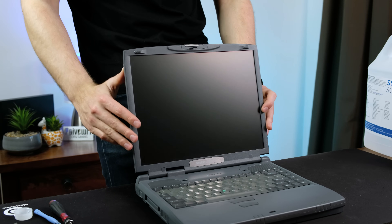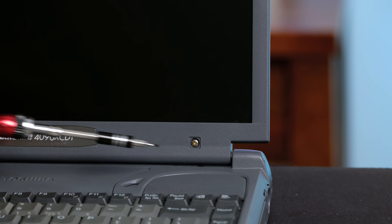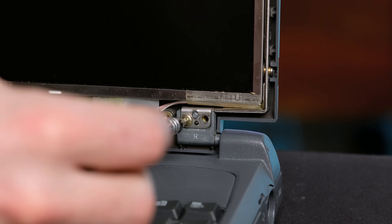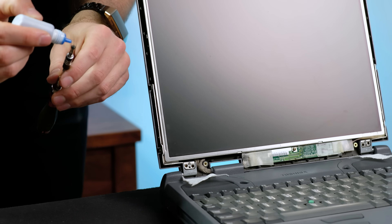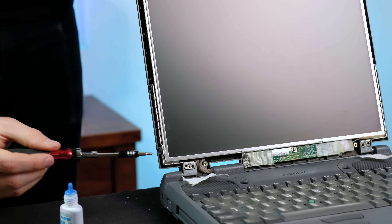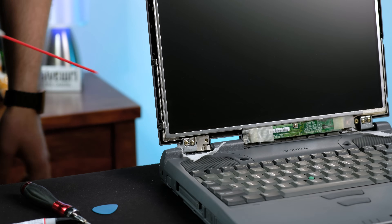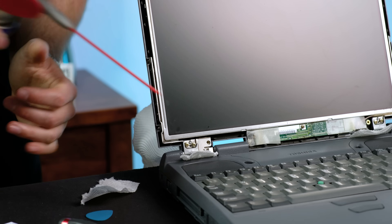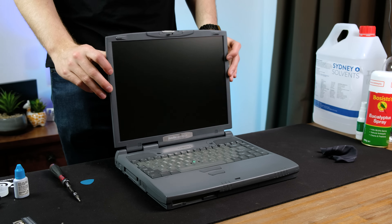We still have a very big problem — the hinge is so stiff that it feels like it's going to snap. To open up the display assembly, I removed two hidden screws and carefully unclipped the plastic bezel with a spudger tool. A metal piece runs partway up the display to help give the hinge strength. I removed the screws holding the screen in place — they were quite loose, which was concerning. I added some threadlocker to the screws holding the reinforcing bracket, and with a tiny amount of superglue and threadlocker, I put the main screws back in. To loosen the stiff hinges, I applied some WD-40. At first they were still very tight, but after a second spray, everything started to move a whole lot smoother. Then I clipped the casing back on, put the screws back in, and reapplied the covers.